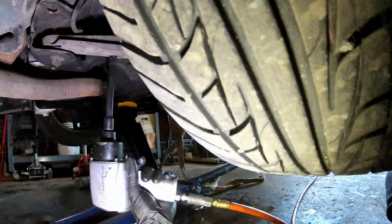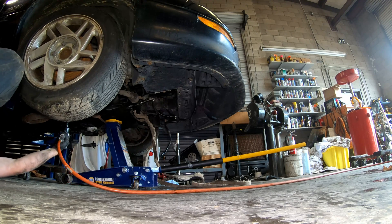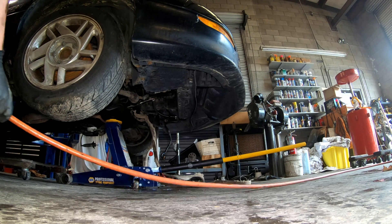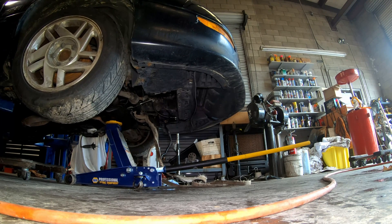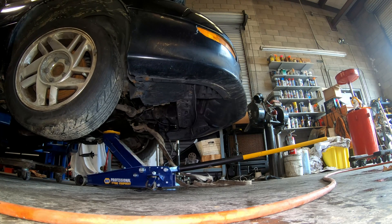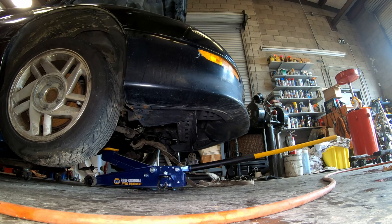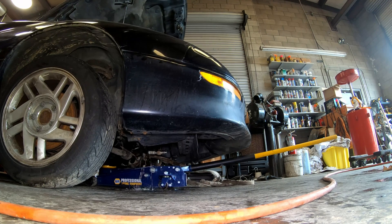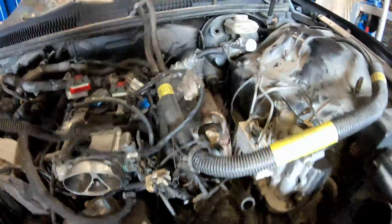You want to stay clear while you're lowering it. Now we're going to lower the car at the same time we lower the jack. Now we're going to remove the strut bolts, and then we're going to lift the car off the cradle and it should be free.